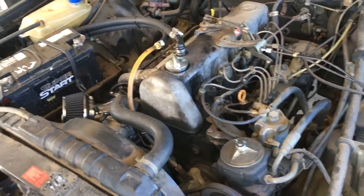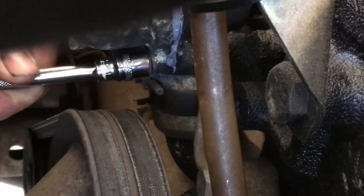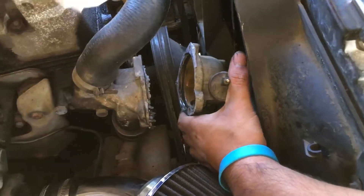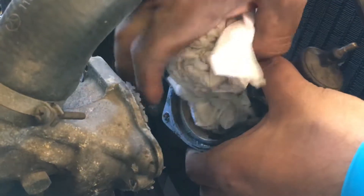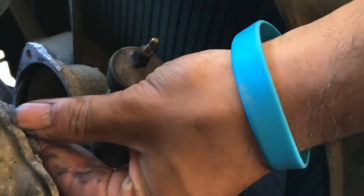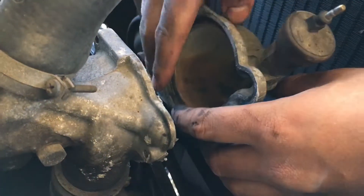Washed the tank, and we got the drain plug back in. So the car's empty. Now we're going to do our thermostat. One bolt here, one bolt there, and there's another bolt right in the back. Many people take the lower radiator hose out, but that's unnecessary. No gasket. I usually like to clean it out — it seems pretty clean in there. I'm not going to go full out because I already did the flush. Go ahead and scrape all this old RTV off. All of this stuff is no bueno when you put your new thermostat back in — it's just going to end up causing issues.